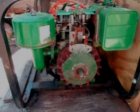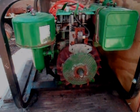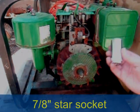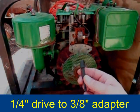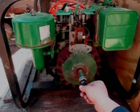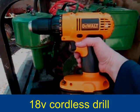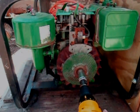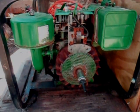I went on the internet to find out different options, and I actually came across several YouTube videos that said that this spindle right here can accommodate — this is a 7/8ths socket for this on there with a 1/4-inch drill driver and a 3/8-inch socket adapter — with my 18-volt DeWalt cordless drill, and this will turn over what I believe is called the flywheel and start it.